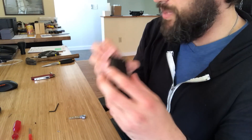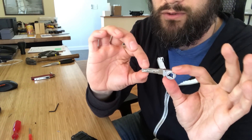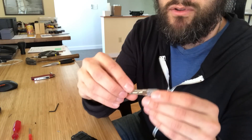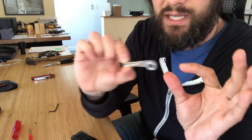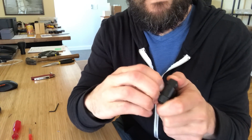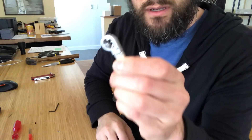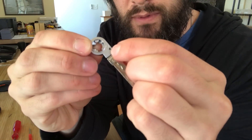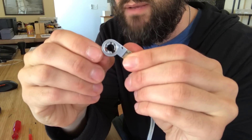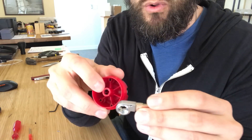The other piece is your emergency key, and you have a couple of options. Some Jeep Wrangler JL owners don't use it at all — they have a soft top and never lock it. Some were interested in a hide-a-key version, hiding it on the vehicle. You can leave it on a key ring, or there's a little pocket in the back of the fob where the key will fit. However, to get the key back there the knuckle has to be removed, and to remove the knuckle you have to knock out a sixteenth-of-an-inch roll pin. You need a block of wood with a hole for the pin to drop into, a hammer, and a punch or small nail that's a sixteenth of an inch or less in diameter.